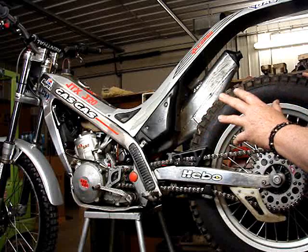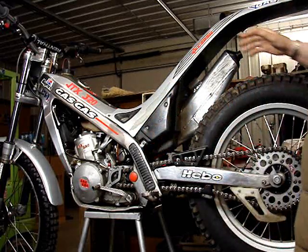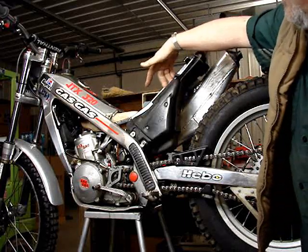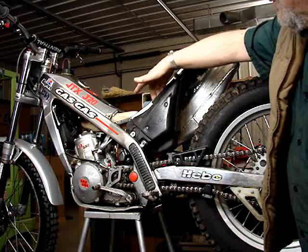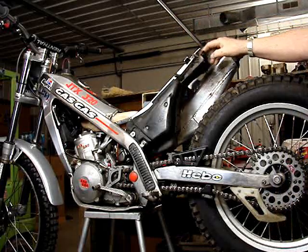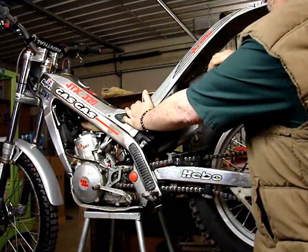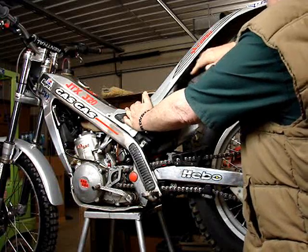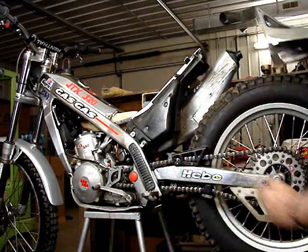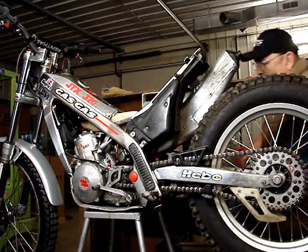This design is 96 and 97. This filter goes in the side here on this box. Taking this off again — this box breathes in the top, right here, and I have some photos included in this video. So, if this piece is not in place — say your mud guard is on there but this piece is not in place — then debris from the wheel goes up and gets in there and goes right into the air box. I've seen some unbelievable things; I've seen air boxes almost entirely packed full of mud.